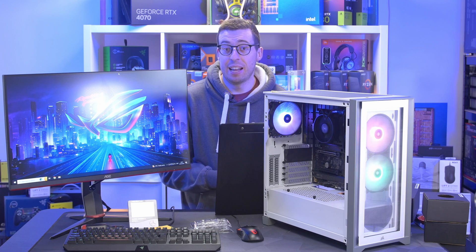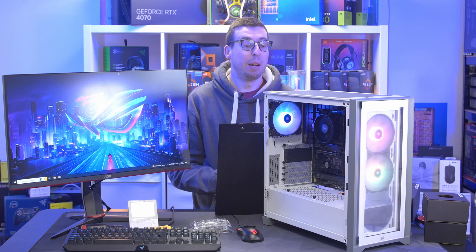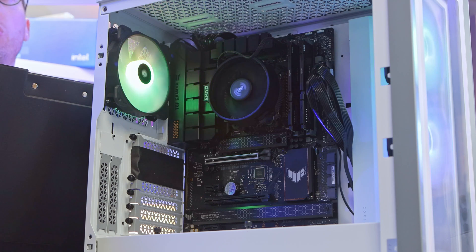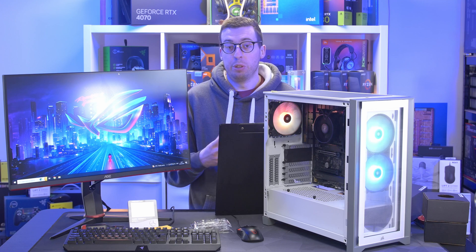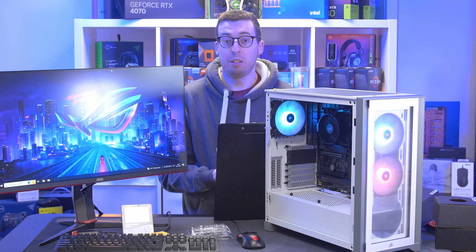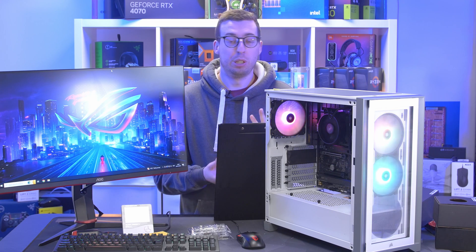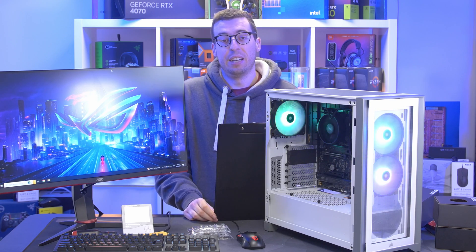Out of the stack, the 8600G stands out for me. The 8700G's additional two cores and four threads are a nice thing to have, but it bumps the price up considerably — especially for a budget-oriented build, which I think these are primarily aimed at. As I mentioned, these APUs are limited to Gen 4 for storage and graphics. Gen 4 storage is wicked fast anyway. With the 8600G you'll be limited to an x8 PCIe bus when adding a GPU — not a major real-world issue. But the 8500G drops to x4, which I wouldn't really recommend.